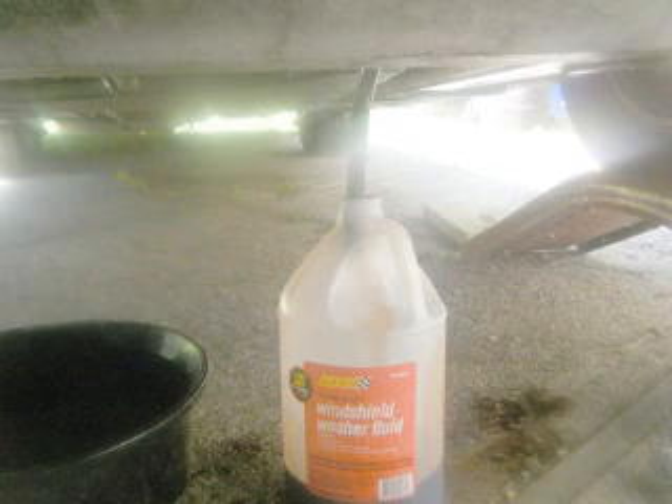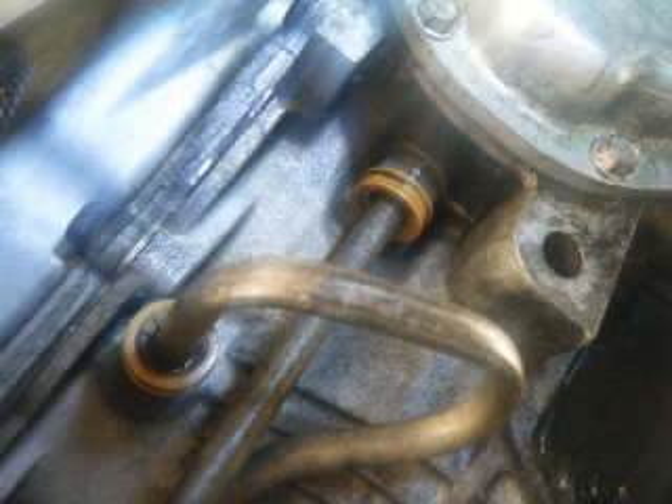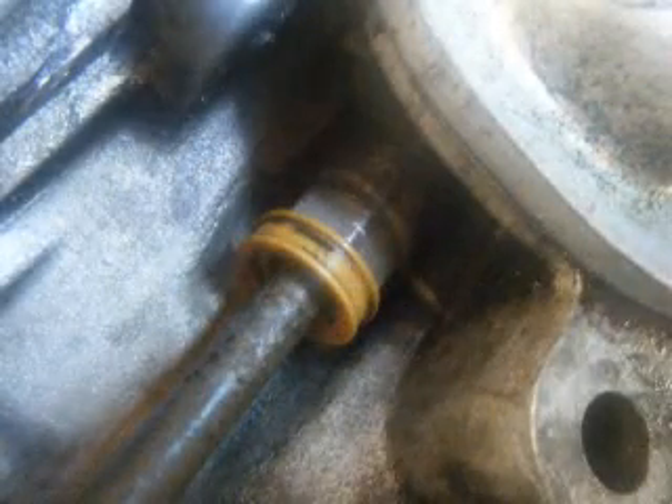General Motors states that it should pump out 2 quarts in 30 seconds. I've secured the line back in, put the clip back in, and slid the plastic cap over.